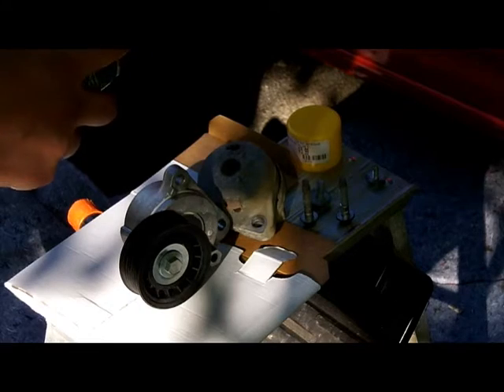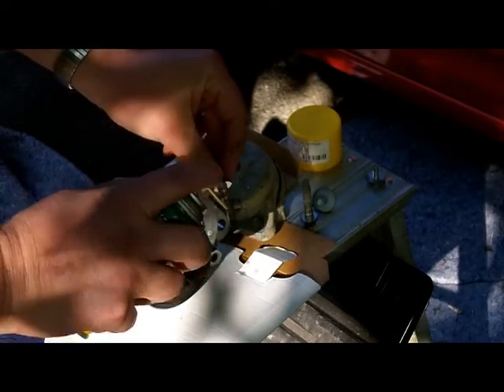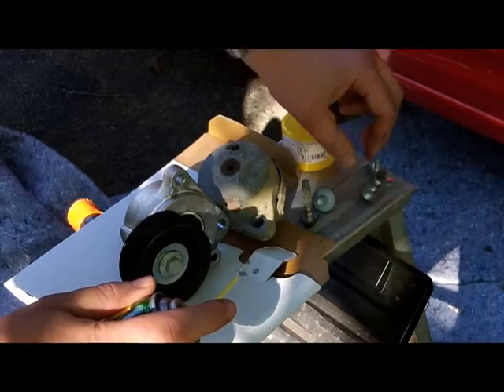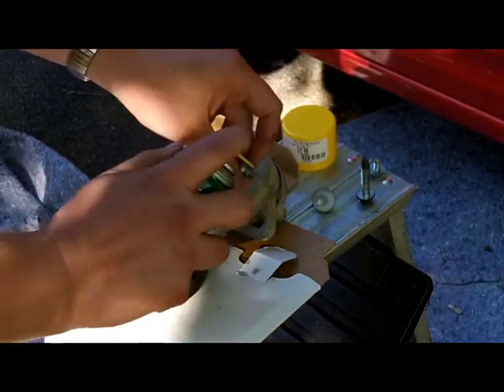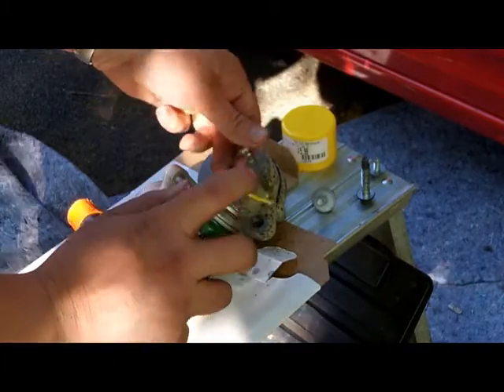For the rest of the video you'll see me going in from underneath to install the new one. You don't need to take the wheel off to get your tensioner out, you can leave it intact. When you're replacing these tensioners you're going to use the same hardware to reinstall it — the same bolts — so take care of them. Make sure you oil them up for a long life.